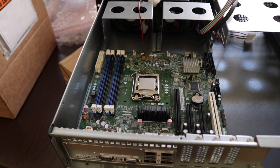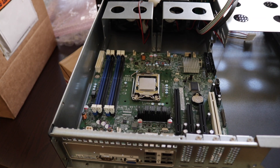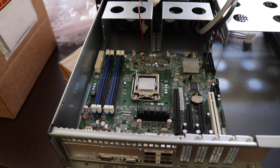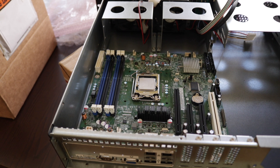The CPU is in. Now the manual says I should install an active heat sink, but I'm planning to use a passive one. I'm really hoping the board boots without a fan attached — they are very emphatic about the 'active' part. We're using E3 CPUs so we should be okay, but if not, I can possibly use a fake fan or a dummy header so the system thinks there is a fan.